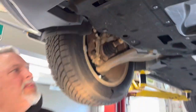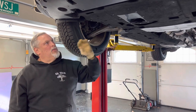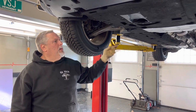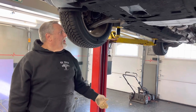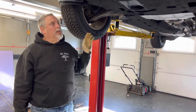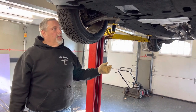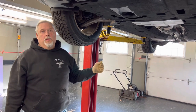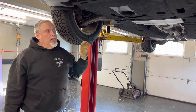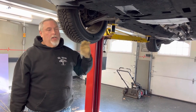We've got the cover back on. We made sure the oil drain plug was tight, oil filter was tight, wiped everything down, and inspected for leaks. This is also a good time to check all your tire pressures. We're going to check all the fluids, belts, and everything while you're doing your service. If you're going 5,000 miles between oil changes, just get in the habit of checking tire pressures, looking at your tires, and giving the car a good look over.